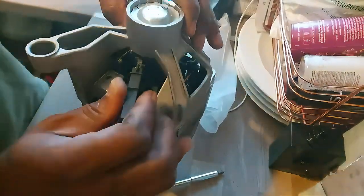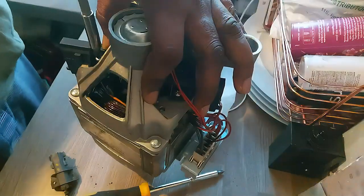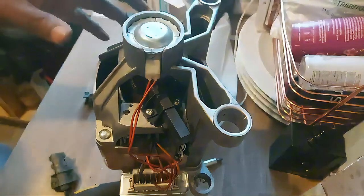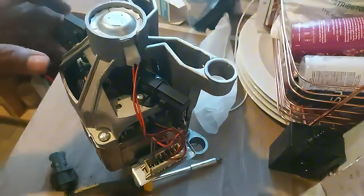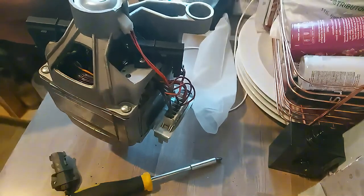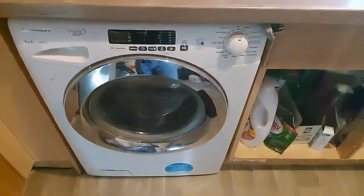Remember to press the carbon against the coil. You can see that's done — easy to replace. You can see the carbon is pressed against the coil inside there. Now we need to put the rotor back into the washing machine.